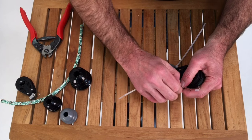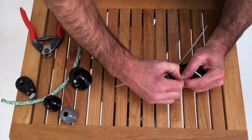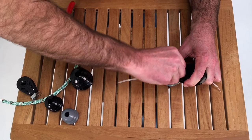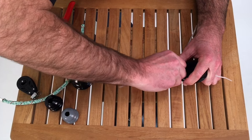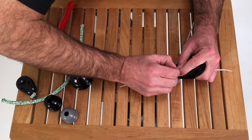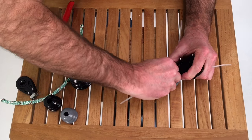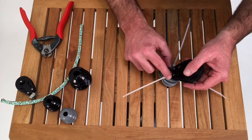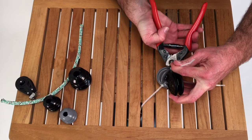I've got a standard ring ding here, not a pigtail one with a bent starter, so I have to get my nail in there and open it up manually just to get this thing started. I'm going to push the PVC down and the block over all at the same time, and with a two-finger grip get this ring ding right in there — get it started, rotating it, pop it up. Now it's started and I keep rotating it. Don't leave the ring ding up — force the PVC to the side, tuck it, and pull it up over.